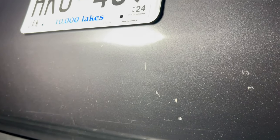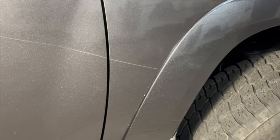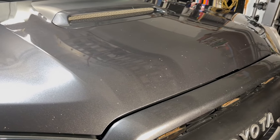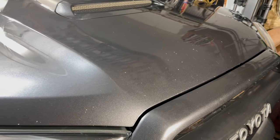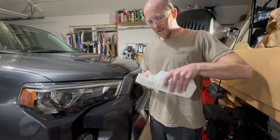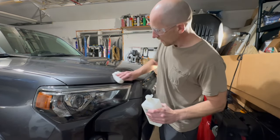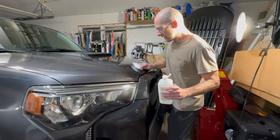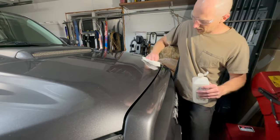You can really see some of these scratches on the liftgate, so we're going to try to blend those in and see how well that turns out. There's a long scratch down the side from a tree branch that's not super deep, so we probably won't worry too much about that. Now that all the paint chips are cleaned up, the next step is to clean each spot with some alcohol to remove any grime, dust, and debris to ensure good paint adhesion.